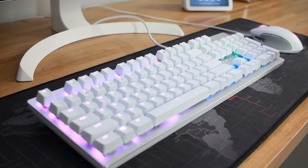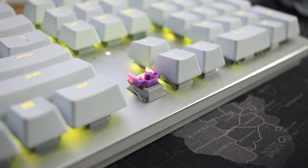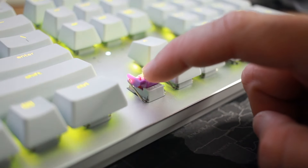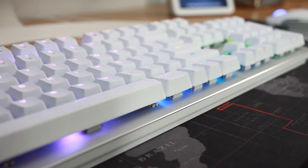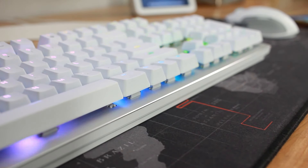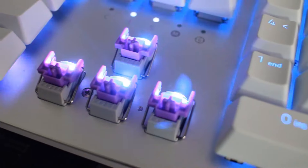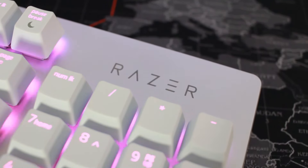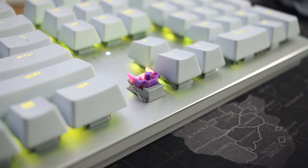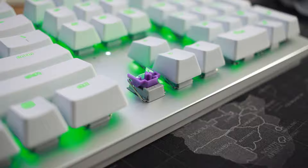The main selling point on this keyboard, other than the Mercury white color edition, is actually the opto-mechanical purple switch, which is the equivalent to Razer's green switch. It still remains the Razer clicky optical switch, but the difference is that it's 30% shorter in its actuation than a regular mechanical keyboard. Razer claims to be the only clicky switch to actuate at about 1.5 millimeters of actuation distance, which is about 30% shorter than other clicky mechanical switches, and it only takes about 45 grams of actuation force to trigger the switch. By having lower actuation, you get more keypresses and less wear and tear — Razer claims about 100 million keystrokes on each one of these keys.